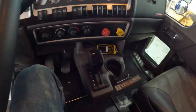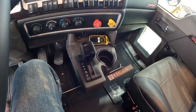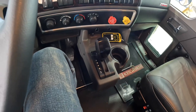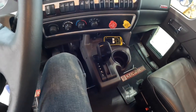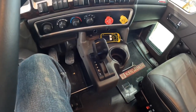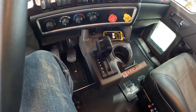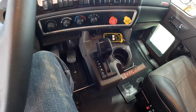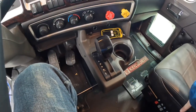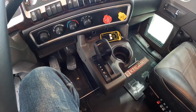We went with Ultra Shifts on these trucks — the last couple trucks we've bought have all been Ultra Shifts. We really like them. The biggest thing is I'll jump in a truck and it's grinding because hired guys have wrecked the clutch brake — they don't understand how to use it. With Ultra Shifts it's pretty difficult to wreck the clutch brake. They're still an 18-speed, same guts as a RTLO 18-speed Eaton transmission, so they're definitely built tough. The clutch is about eight or nine grand to replace, which is the one concern.